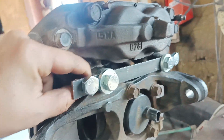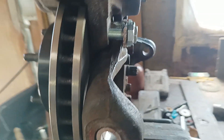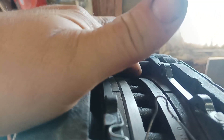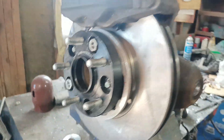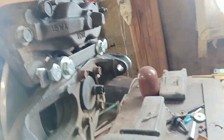There's going to be a spacer in here. Right now it is resting on the back flange of the knuckle, so it has that height. Here is the Mark IV Supra rotor — it's pretty big, I think it's at 12 and a quarter. What I might do is space this side down just a tiny bit, because we're just maybe a 30th of an inch above the brake pad onto the rotor. Not the end of the world, but if we can get it nice, we might as well. We get nice pad contact. I had to cut the dust shield off, but we're clear. Just got to transfer this over and drop that side down just a tiny bit.